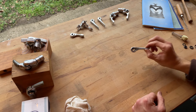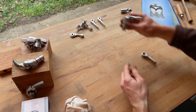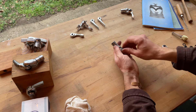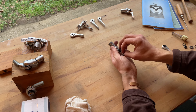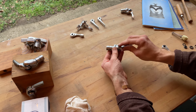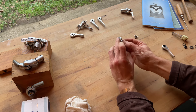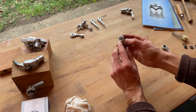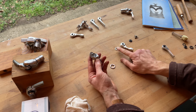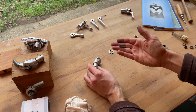Now we're going to take Pam's left side shifter and I'm going to show you how to install it on a left side bar end pod. So we're going to unscrew the wing nut, remove the plastic washer, remove the shifter body. You might want to put your finger over this part right here to keep everything from falling apart. Turn it over and two washers will come out: there's a thick steel washer, there's a washer with a window, and then this little knob comes out too.